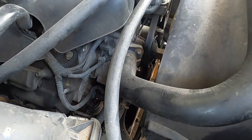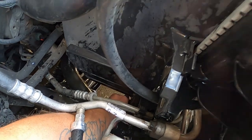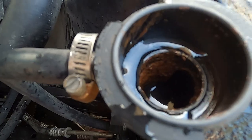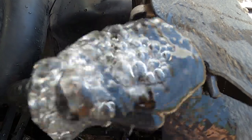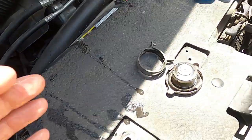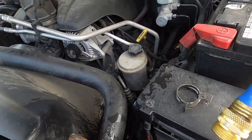Then we'll pull the thermostat out and do the same to the engine block. Here's another way you can tell it's clear: take your hand, cover your lower radiator outlet, pull your radiator cap off, and watch — see that clear water coming out? So you know you've rinsed that radiator completely out. At that point, pinch off your hose and pull it out of your upper radiator socket.